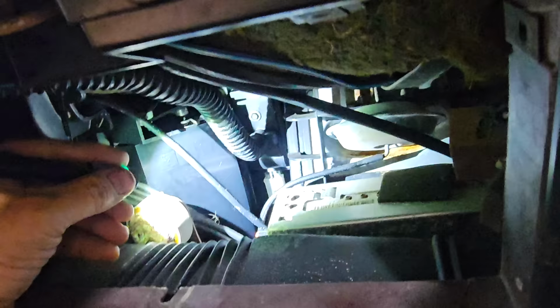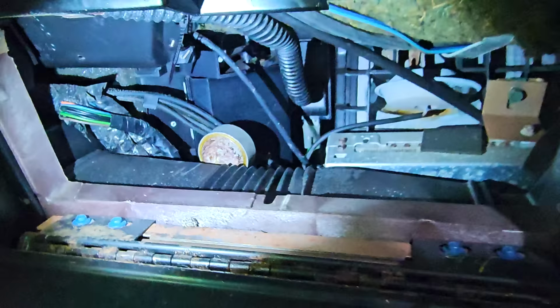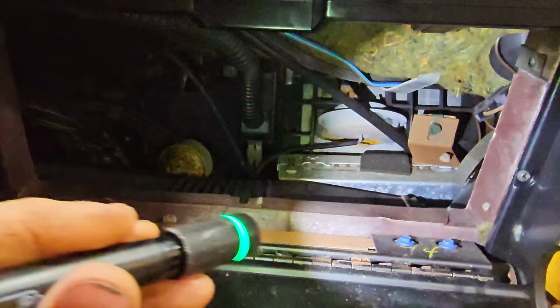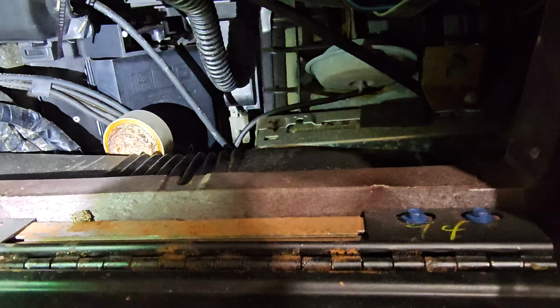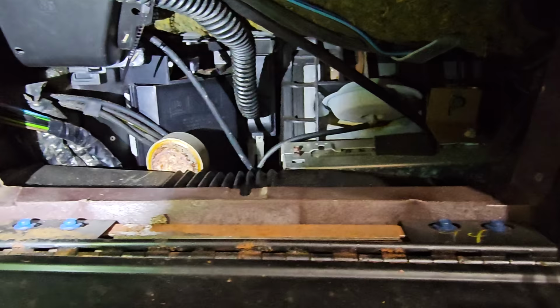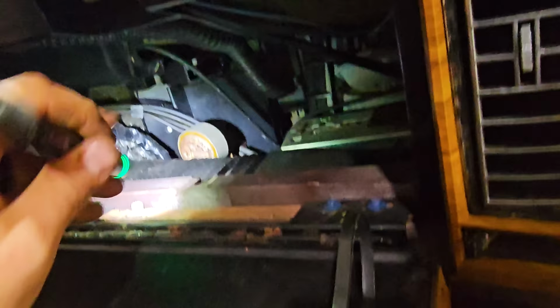More importantly, we got this beep boop box right here, which has wires shooting out of it, right? On this side, I know that's a vacuum fitting. Where's the line? There ain't a line to it. And that is going to be one of the connections that this thing is looking for: coolant, MAP, which I think this is, TPS, and things like that. So, let me get the book out again, figure out what that thing is, and figure out where the line is supposed to be, because I'm not seeing anything loose or hanging in here at all, yet.